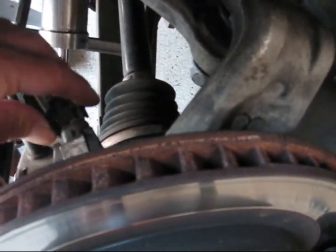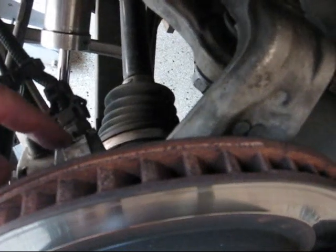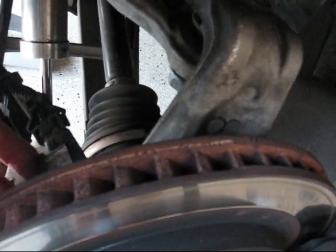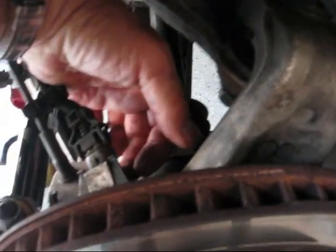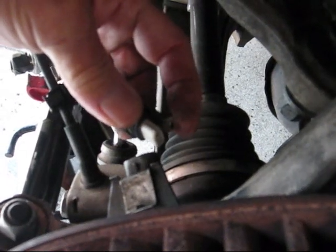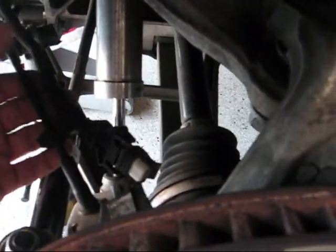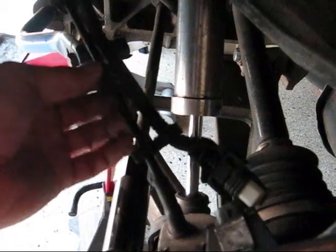What I noticed on this one was it was quite loose — not loose where it connects and snaps in, but this little metal clip that holds it onto a bracket that holds it onto the hub was loose. If you reach on the lower side there's a little clip that you just pull on, then pull backwards kind of at the same time. That's how you disconnect your wheel speed sensor. In the back they're attached by a couple more rubber clips to your parking brake line.